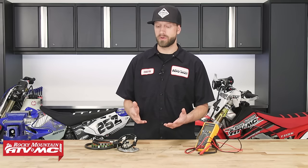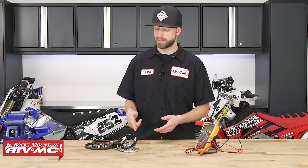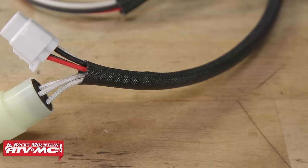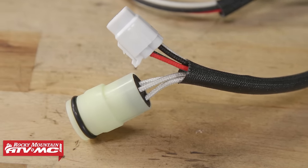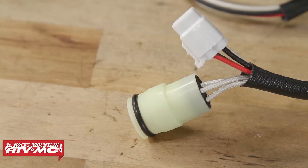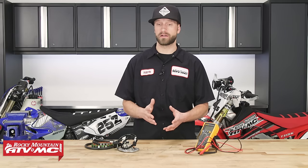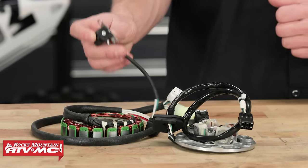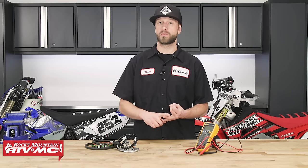Now to tell which type of stator you have, simply look at the connectors that are coming out of your ignition cover. Follow the harness out of the ignition cover up to the connector. Like over here on our CRF450RX, you can see that the connector has three of the same colored wires housed in a single connector. These three wires can vary in color — they can be white, black, or yellow. The single phase stator is not going to have these three same colored wires. Now the stator along with the charge coils can usually be accompanied by a crank position sensor, also known as a pulser coil, a pickup coil, or a trigger coil. They are all the same thing.